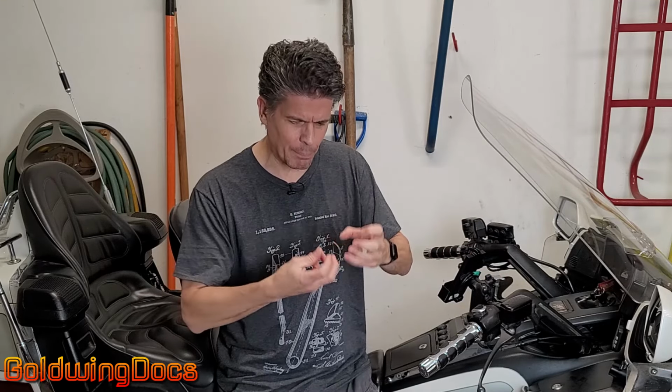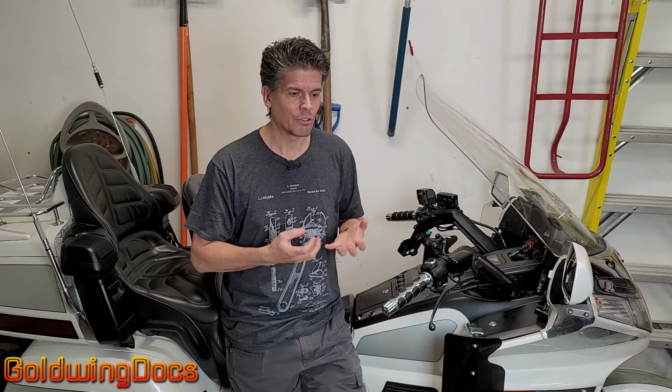The first time I did this on my bike, I thought, I do oil changes all the time. My bike is going to be nice and clean. I'm not going to really need this. I was astounded at the clumps of tarry goo that came pouring out of my oil when I did this. So now I do it once a year just to keep that sludge out of my engine. If it's really bad, you may have to do it twice. So put fresh oil back in the engine, more Seafoam, do it again, drain it out again.